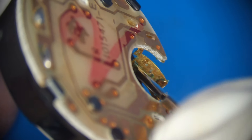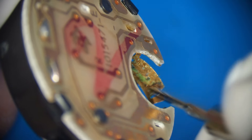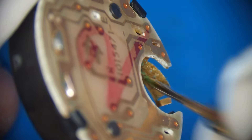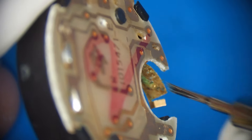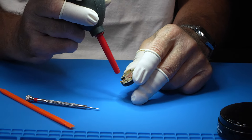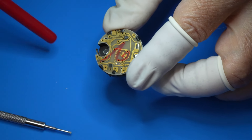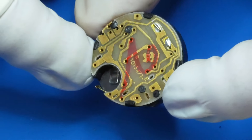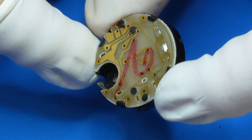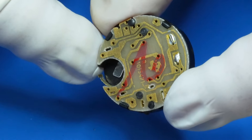I'm going to come back with a cleaning swab with some distilled vinegar. This buildup is alkaline and the vinegar is acid, so vinegar can neutralize this type of battery buildup. I'm giving it a very light puff of air trying to get it out of the watch and have it land on the work pad — I don't want to be breathing it. Once we get this little battery well cleaned up, we can put in a new battery and see if the watch lights up.